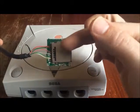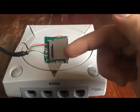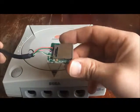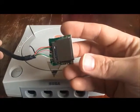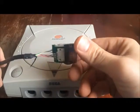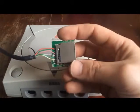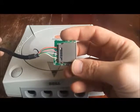As you can see, you miss out the first pin, then solder the next seven pins, then miss out the eighth and ninth pin. It's got a PCB on the back. I ripped this out of a PC as I wasn't really using it. I've just soldered it straight onto the pins. It's quite fiddly to do, but just as long as you use a fine tip soldering iron, you should be fine.